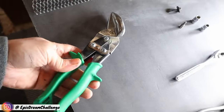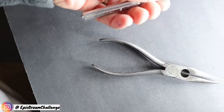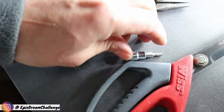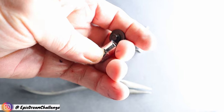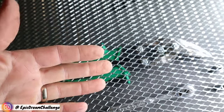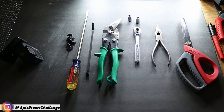Okay guys, the material for what we need is super easy. What we have here is some scissors to cut the zip ties, needlenose pliers to pull some of the zip ties through to make it a little easier. We got a little wrench, a one-fourth socket with a torx star bit, and a seven millimeter socket for the nut bolt. The metal shears, the actual lap mesh from Home Depot — a whole giant roll which could do probably three or four Corvettes for only $12.99. Also we're using zip ties, a screwdriver. Those were all the tools.